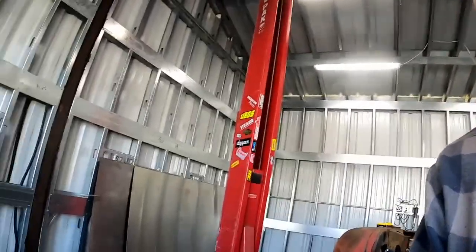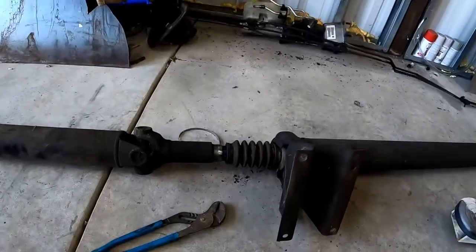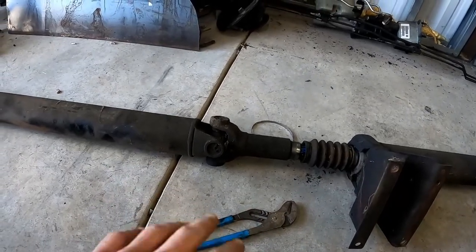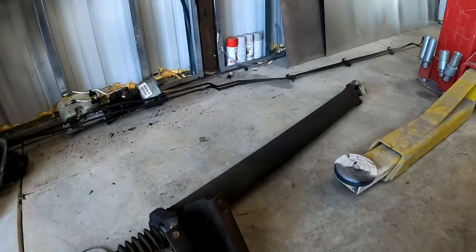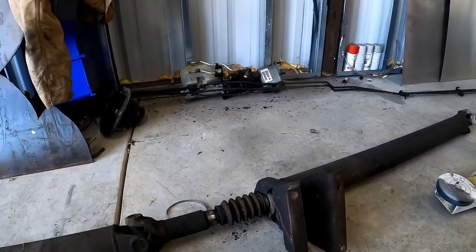One of the reasons I never took in the manual driveshaft to get shortened was because I wasn't sure about the plan. I am starting to take the driveshaft apart now. With BMWs, two-piece driveshafts are balanced as one piece, but I'm not sure if it matters here. I'm going to use the back half that's currently on the truck and get the front half shortened — I don't know if that'll cause vibrations, but maybe one of you guys can clue me in. This is probably going to have to be shortened by about two feet, though I won't know for sure until I get the transmission in.